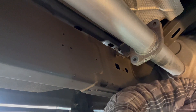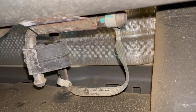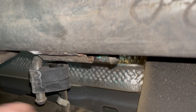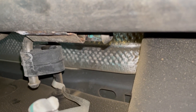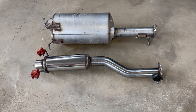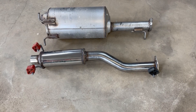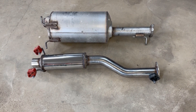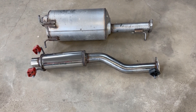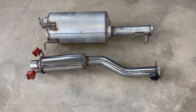The exhaust is now just held on by the hangers, so I'm going to spray some WD-40 on there and get those hangers off. I also want to note there is a ground strap — it's just clipped on. You can see I just pulled it off, so you'll want to reattach that to the new exhaust. Prying off the hangers now. Those rubber hangers wouldn't have come out without WD-40, so make sure you have lube handy.